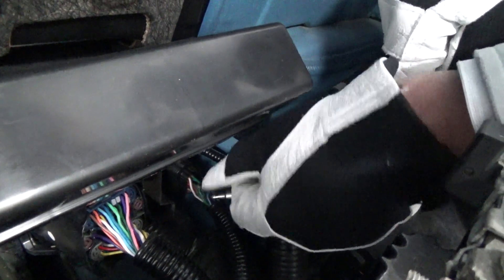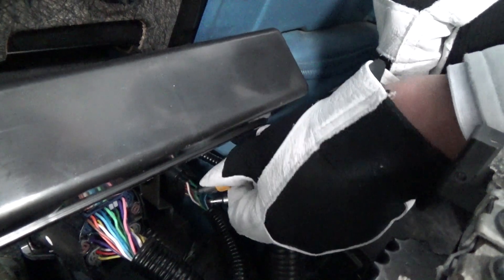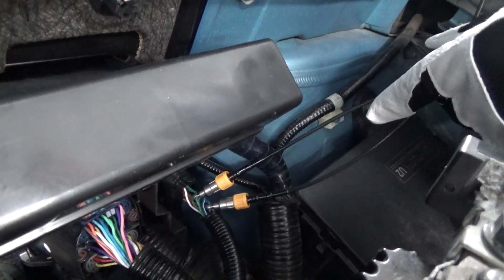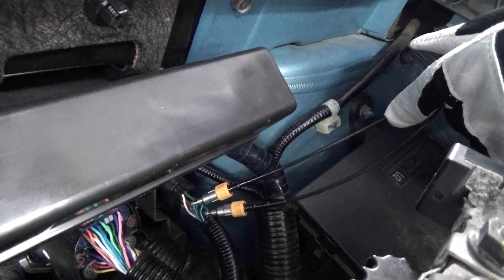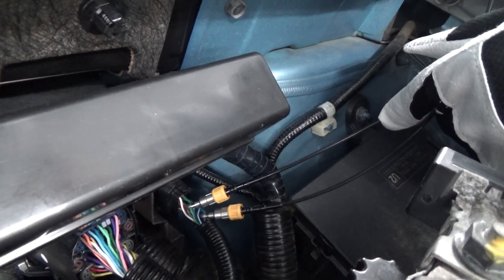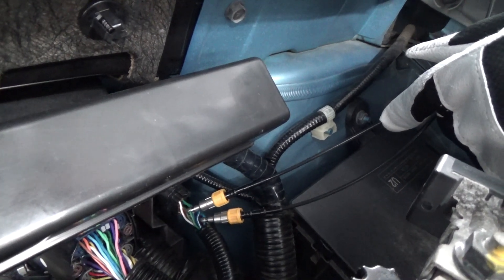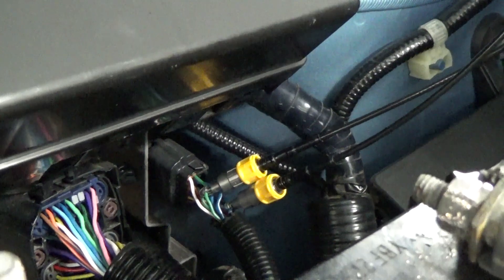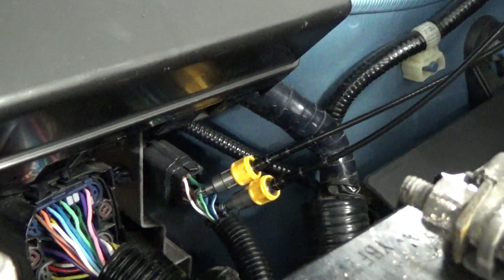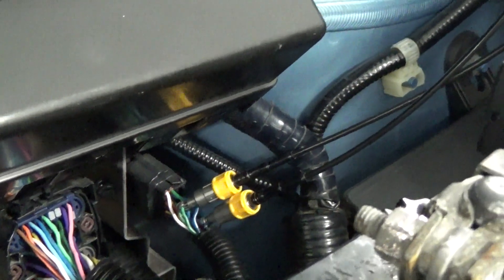CAN is made of two differential voltage lines. Attach a probe to CAN high and CAN low. Hioki's unique technology allows for voltage sensing from outside the cable insulation. Damaging metallic contact is no longer necessary, so there is no worry of changing the electrical characteristics or interrupting communication.